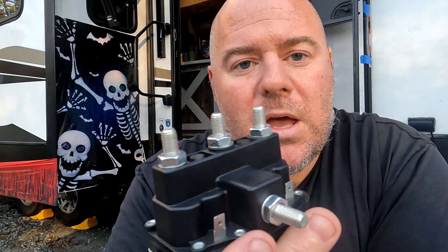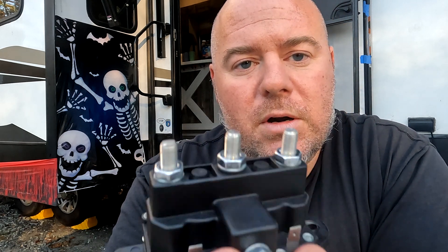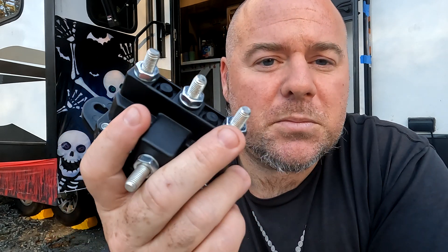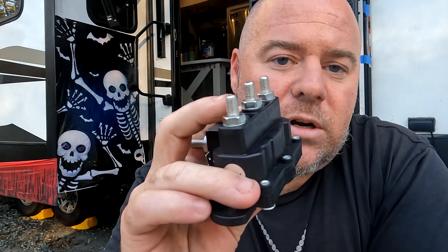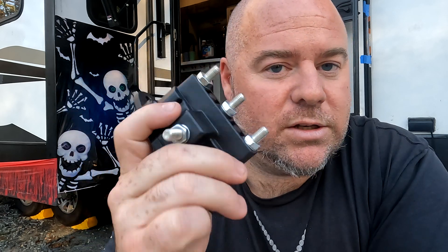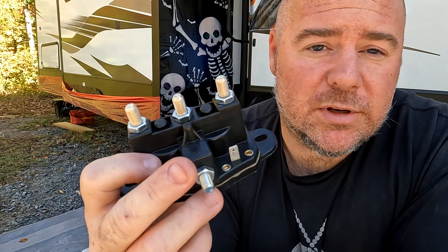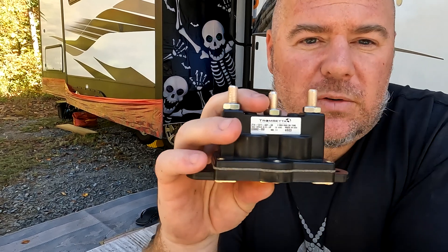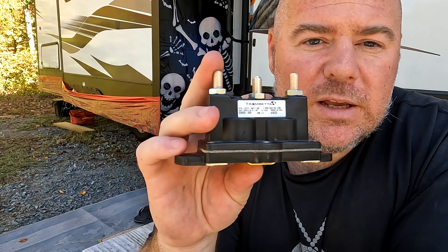You can research these online — there aren't many out there. Buyers makes them, Cole Hersey makes them. If you don't know exactly what you're looking at, I would definitely call the manufacturer of your trailer with a serial number and order up exactly what parts you need. There are load rating differences, amp rating differences, and usage intervals — some are made to be intermittently used, some are made to be on all the time. These systems have 80-amp breakers and are designed for 80 amps runtime and about 125 amps spike on initial startup. Do your research, and if you don't know what you're looking at, just call the manufacturer. The amps and loads are listed on the backside of your reversing solenoid.